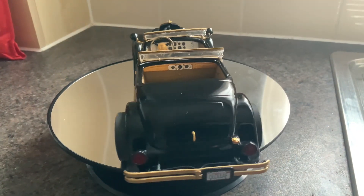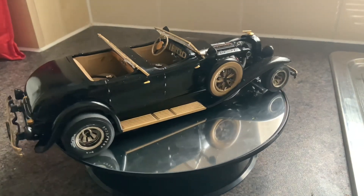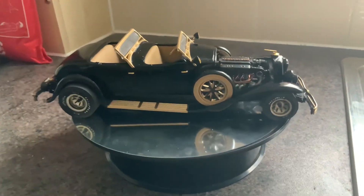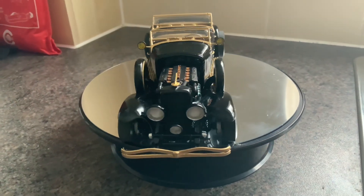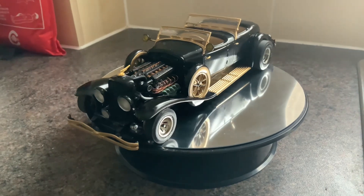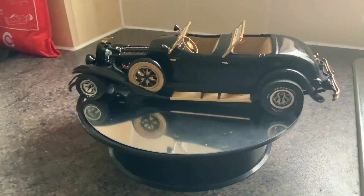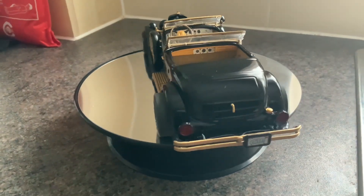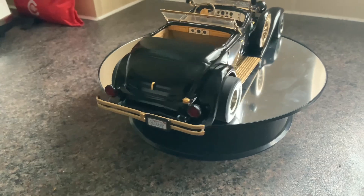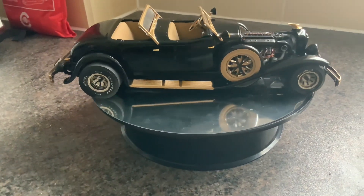Just changed the wheels up. Just lowered the front down as much as I could, because it's sitting pretty high at the front there. And all of the lights as well — it had a bar running across, the lights were fitted on a bar. So I took that off and fitted the lights straight to the body. The rear lights — there was a bar that runs through there to connect your rear lights on, but it was missing, so I had to make another bar for that.